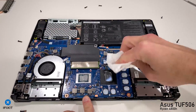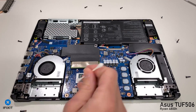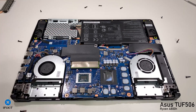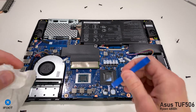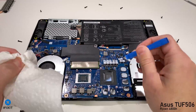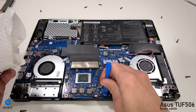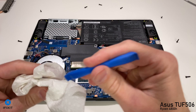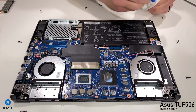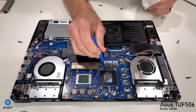Welcome to my teardown nightmare. I was hoping to see thermal pads instead of thermal paste. Thermal paste does just as good of a job on top of the memory modules and chokes and all those components, but it's very messy, and as somebody who would prefer to repaste their machine usually twice a year, that is excessive. I would personally prefer to use a very thin thermal pad, maybe a 0.5 Fuji Poly, something like that — if I were to keep this machine.